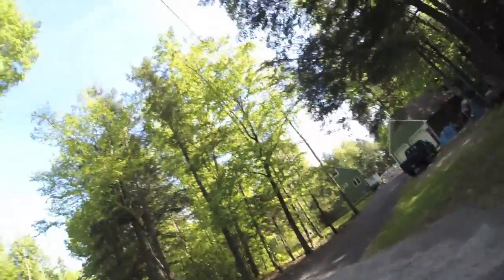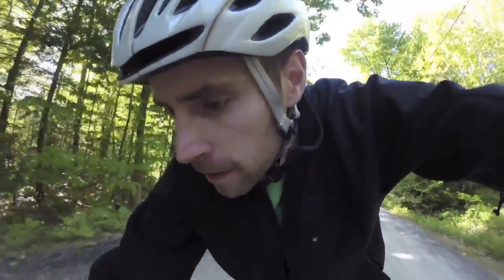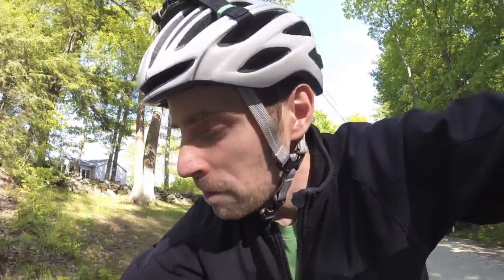And actually, let's see. I'm in nothing mode here. Let's see if regen will still work. Pedaling, you realize it's a bit heavier when you're not using the motor. Yeah. And regenerative braking still works even if you're in nothing mode. So that's cool. You could just be using this like a bicycle, getting a workout, and then as soon as you pull the brake, you're getting a little bit of assistance from the motor in stopping. And then of course there's full-on regen mode, which would help us descend that hill we were looking at a minute ago.